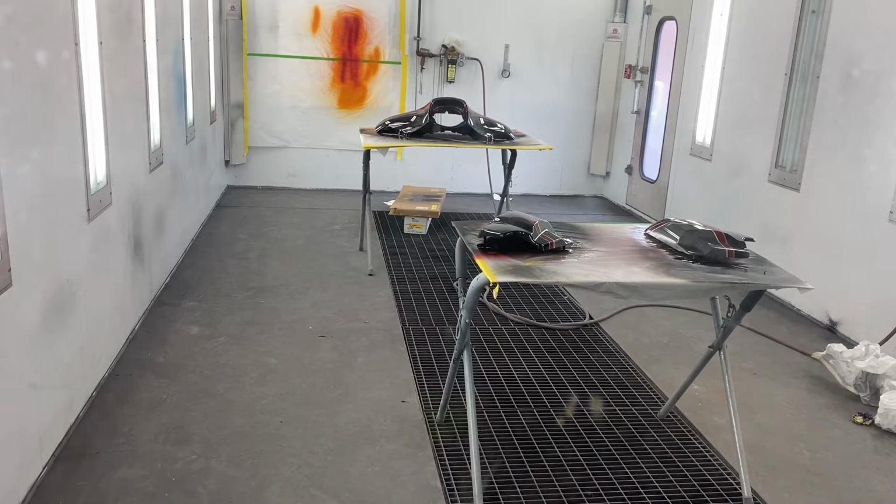Okay, it's been a little over 5 minutes. I'm gonna go in and check it. If it's ready for another coat, I'm gonna put another coat on. It needs a couple more minutes. I'm really putting it on heavy, and where it had all those tape lines for the different colors, the clear will actually hang on that like a gutter, and it can only hang there for so long, then it'll run. So I want it real good and finger slick is what they call it. It's when I can run my finger across it without it sticking to my finger, and I don't want any of this stringy, I don't want it sticking and pulling away from the panel at all, if that makes sense. I'm still waiting to go in and put the second coat on.